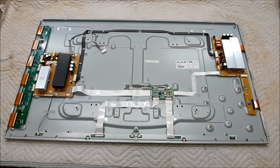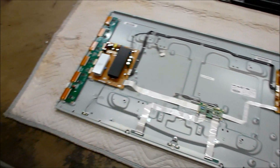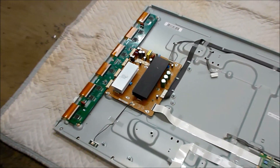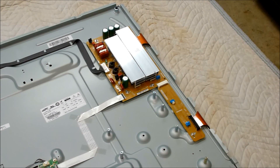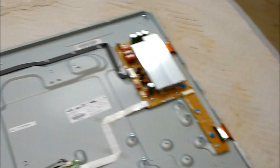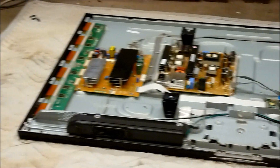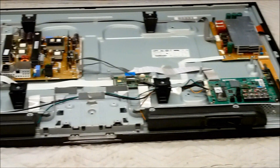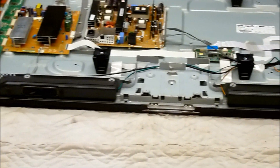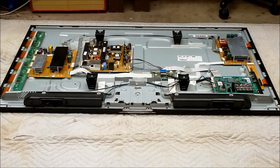The first thing I've done is unpack the new plasma panel. This is what comes with it: a new Y-sustain board, new Y-buffers, and a new Z-sustain board — on Samsungs they call it the Y-main, and the other one is the X-main (on an LG that would be the Z-sustain). The old set still has the Y-sustain and the power supply. We need to remove the main board, take off the speakers and stand mount, and then we can swap the plasma panels. I'm going to pull the power supply, main board, and LVDS cable loose now.